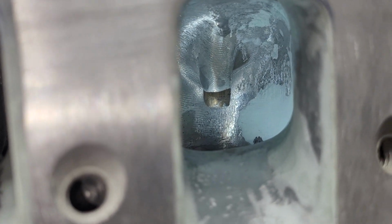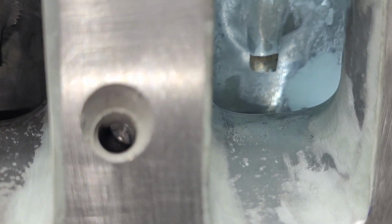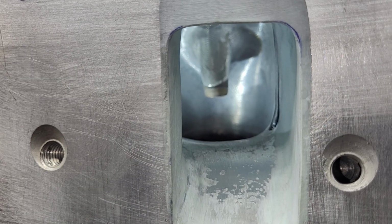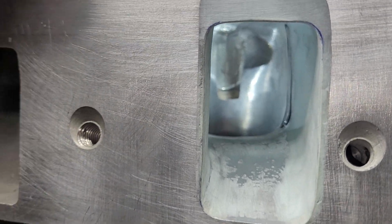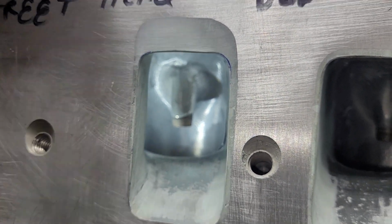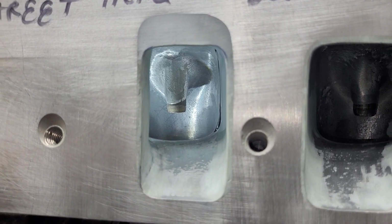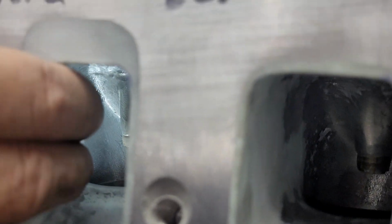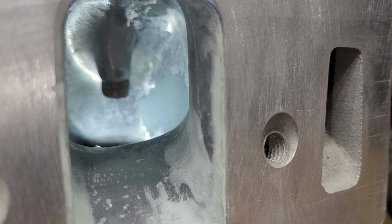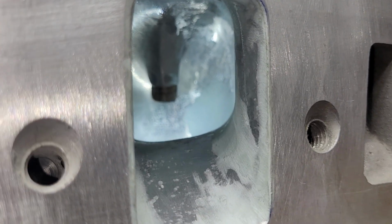Okay? And what I see is, it'll be interesting when I put it on the bench and get some airspeed numbers. But it's also interesting, ports are shaped quite a bit differently. Let's put a light on this one. Now, the owner of these heads has a pretty high-end engine program. And when he did all the flows and everything, he ran both intake ports through the program, and the inner port made more power. But you can see this push rod radius there is much steeper than this one. And I'm willing to bet that this is the longer port.